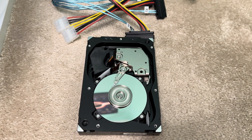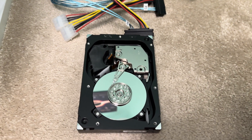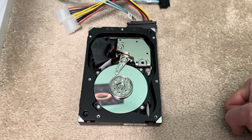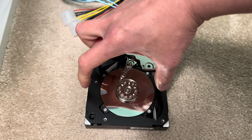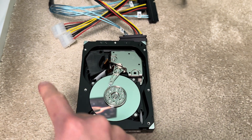And it's spinning down. As you can see, it spins down really quickly. The reason for that is that this is physically quite small, so there's quite little inertia. As you can see, it occupies only a small area — rather, its diameter is a lot smaller than the drive's actual width.